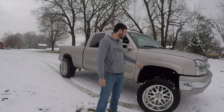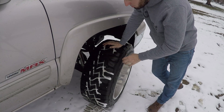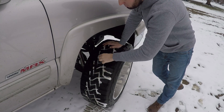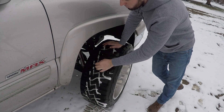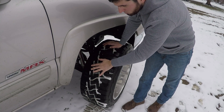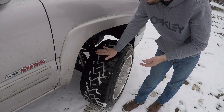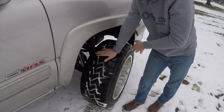I'm going to bring you in a little bit closer so you guys can see the tread design on these RTs. The tread design on the RT is a lot different than your normal mud-terrain or all-terrain tire. If you look at these lugs, they are really the same size as they would be on a mud-terrain tire, but the channels — where there are individual lugs on a mud tire, they're pretty much all connected here on the RT. I think the reason for that is to cut down on road noise; the spacing between the lugs is not as big, which helps on the road. There's a lot more surface contact with both the road and the ground, and you can see where the snow gets down in the channels and is supposed to expel out through the sides. That's another reason all those things combined help in the snow — mainly it has to do with the amount of contact the tire has with the asphalt, grass, dirt, whatever you're driving on.